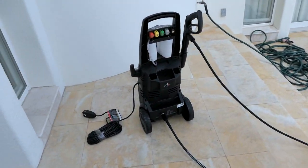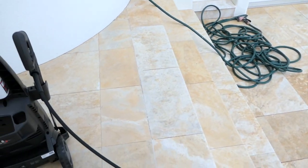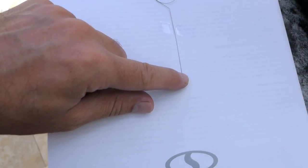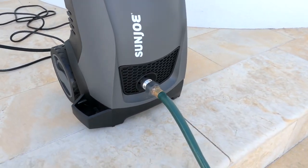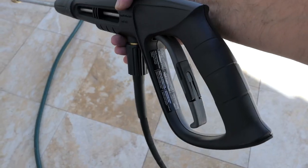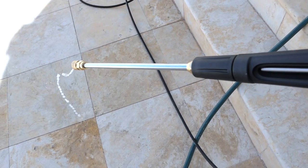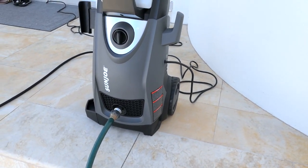This is what 20 feet of hose looks like — not very long, but a decent amount. The power cord is quite long though, so we should be able to reach easily. By the way, on the back of the manual there's a little pin or needle for cleaning out the nozzle — interesting. Once the power is plugged in and the hose is connected, the first thing you want to do is open the water and before doing anything else, run water through the whole system without a tip installed. This flushes out any dust and gets air out to prime the pump. You can see some white stuff came out — that helps prime the whole system so the pump is full of water when we turn it on.